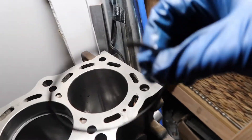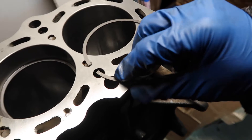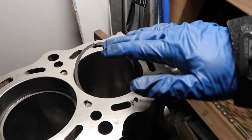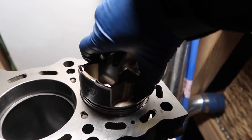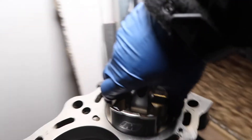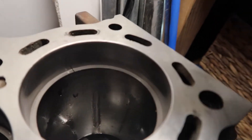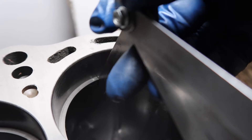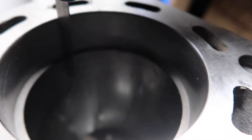Get the ring, make sure the little letter N or dot is pointing up, squeeze it slightly, push it in just a little bit, then turn it sideways — done. I like to use the piston to square it up so all sides are even and you know the ring is straight in the bore. Then use feeler gauges: 0.023 goes in like a knife — and 0.024 might be our number.